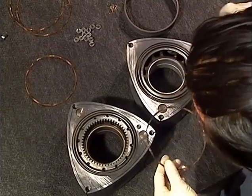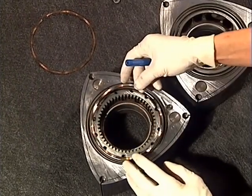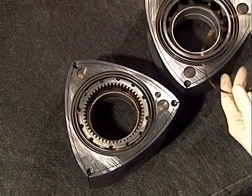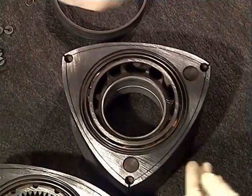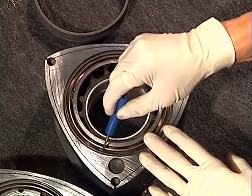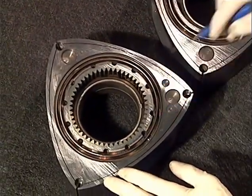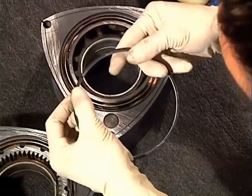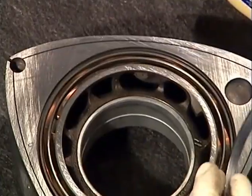With the rotor on the left gear up and the rotor on the right gear down, we are now going to install all the forward facing oil control rings and springs. Pick up your white oil ring springs and with the round tip on the right hand side, place the round tip into one of the little holes in the rotor. With the outer ring spring, place the ring opening as far away from the inner ring opening as possible, making sure the round tab is placed into its hole. Liberal amounts of petroleum jelly on the inside and outside of the oil ring will make the job easier. Each oil ring has two square depressions which will be placed on the square tab facing up on its opposing spring.